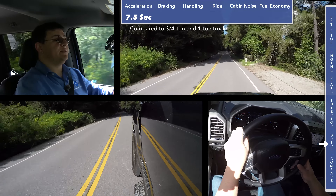Fuel economy is very difficult to talk about with pickup trucks because your fuel economy will vary based on what you're hauling, what you're towing, and which engine you choose under the hood. During our week with the F-250, we spent about half the time — that's about 200 miles or so — with the bed filled to maximum capacity. The payload in this particular trim is just over 1,900 pounds, so we had about 1,800 pounds of cargo back there. We also performed some test towing runs with a 7,000-pound trailer connected, and our overall fuel economy average has been around 12.5 miles per gallon. We are driving the diesel model. Some people may think that 12.5 miles per gallon is a poor fuel economy score, but keep in mind we are driving a very large pickup truck with a high payload capacity and a high towing capacity. I'm going to give this particular model a B for overall fuel economy.